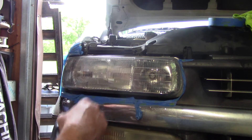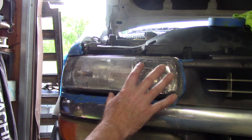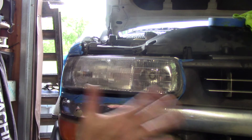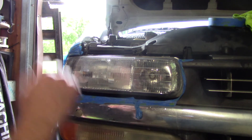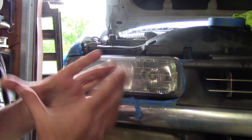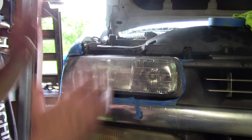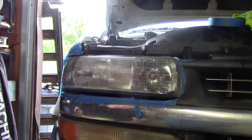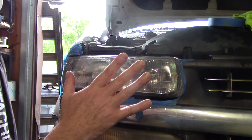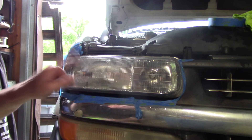Tape it up. 800 grit. You can go to 400 grit, 600 grit, whatever you want to do. If the lens is really, really bad, really yellow, really faded, and you can barely see the bulbs within the lens, don't even think 1500 grit is going to help you. It just isn't, folks. I'm sorry. Chemical Guys has got their fancy little sponge and a piece of sticky tape they put on it and wipe it across the panel — that stuff isn't going to help you guys. Not in the real world. Your customers aren't going to want that kind of service. They'll like it for the first month or two after you leave, then they're going to think, does this guy know what he's doing? You've got to be far more aggressive.